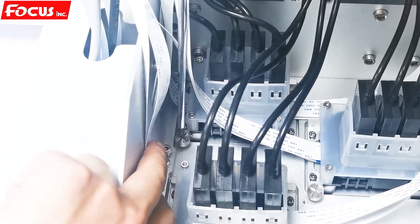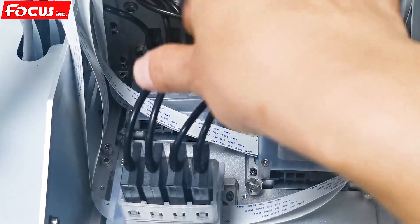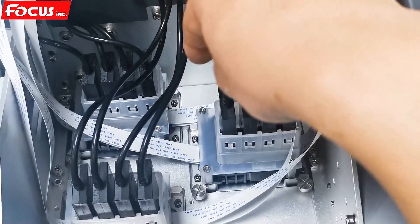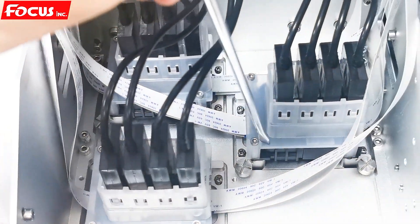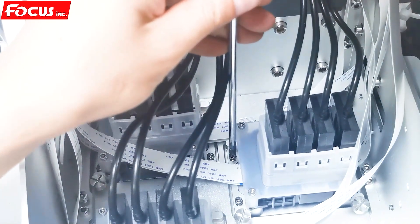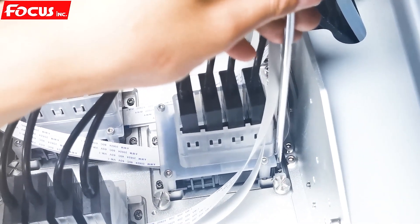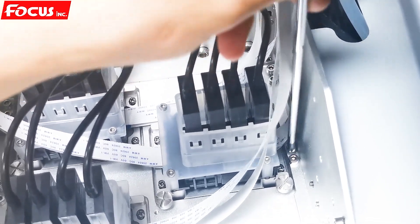We load the adjustment tool because we want to move the print head to the left. This is the color print head here. The white print head is here and the varnish is here. It is hard to see on white paper but you can see the lines if you look at the light. We take the color print head for this test, so we loosen all four screws of the color print head — loosen a little bit each. The four screws are installed on the pallet of the carriage, and the last one is at the back side.